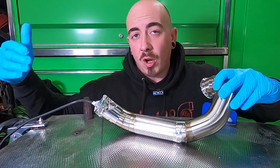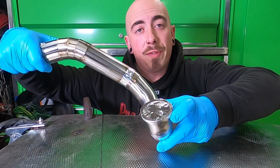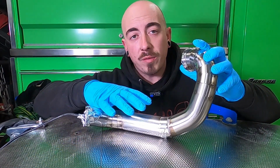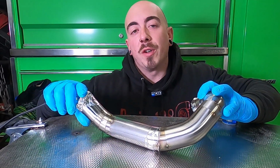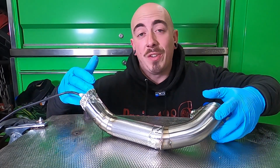So in one end, I've got a line going in with argon, and the other is blanked off with the aluminium tape with a couple of holes in it. So what this is going to allow it to do is fill the pipe with argon, flush out any gas we don't want inside the pipe, and this is in the hope to stop something called sugaring on the inside of the pipe. This is basically a layer of oxidization, which we really don't want there.